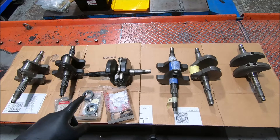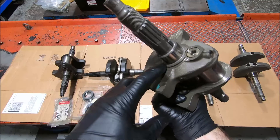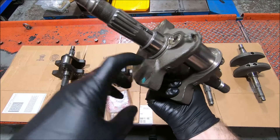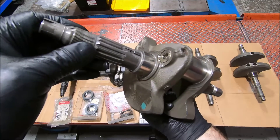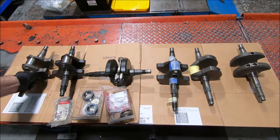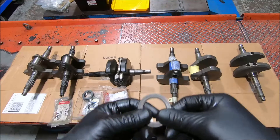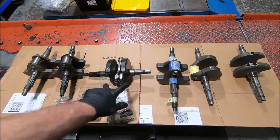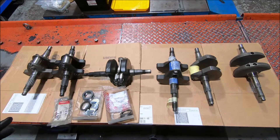When they went to the 659, the difference is this side of the crank has a big bump on it, and there's only one shim on this crank - it's on the right-hand side. They basically just cut down on parts used, but it's the same shims - you just have one shim on the right-hand side.